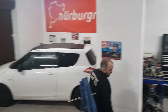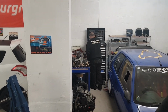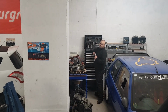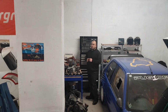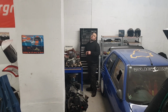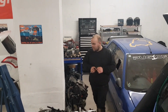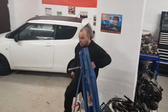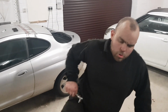Josh decided, when doing the engine conversion, that he couldn't be bothered to sort the power steering pump out that comes off the lorry. So what pressure do they run at, Josh? Well, it wasn't the exact science, because two conversions that have been done before are using slightly older pumps. And they're adjustable, the pressure. That one's not adjustable. Why don't you get an older pump then? Fair enough. Rarer than hen's teeth. And so we just went with what was on there, and I'll be corrected, no doubt, it's over 100 bar, if not more, 160 bar.